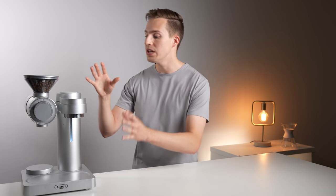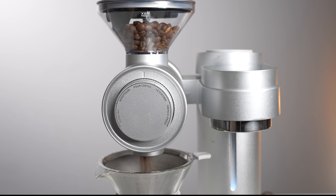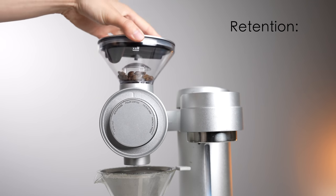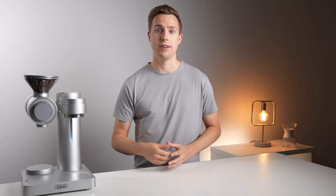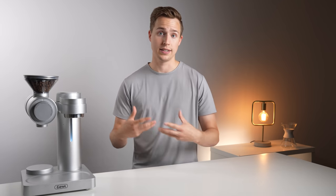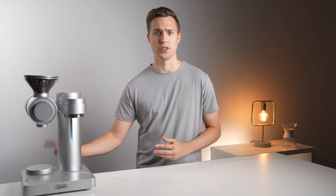We have spent a lot of time talking about the physical machine and all the functions. Now let's talk about how each of the individual components actually performed, starting with the grinder. It was surprisingly quiet, which is a huge plus. Other than being quiet, the grind quality also exceeded my expectations, being able to produce some really enjoyable cups — far more than I expected from a built-in grinder. Retention was also manageable at around 0.2 to 0.5 of a gram, assuming you give the lid a tap or two at the end. As for the grinding range, I was able to grind fine enough for espresso, but you only have about 10 steps in that fine range, so it would be a bit tough to actually dial in a shot. The intelligent dosing modes managed to keep things within a plus-or-minus 3 gram range, but I'm going to recommend that you single dose, especially considering there's a scale built right in.